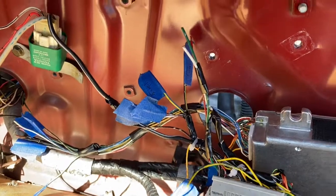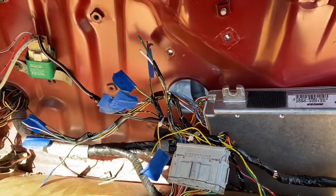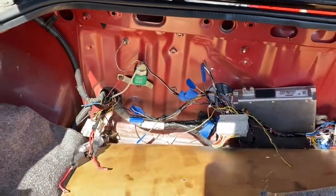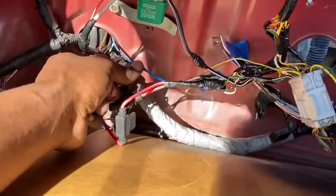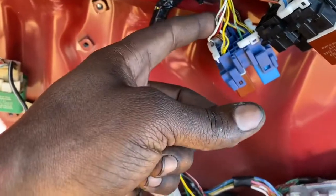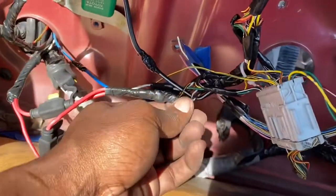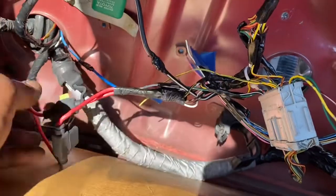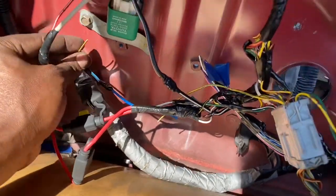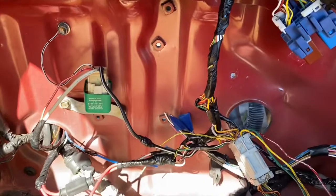I'm gonna connect those for now and we'll come back and show you what's basically left to get the car to start. The fuel pump is now wired up to our yellow-blue wire — I checked that for power, all relays are good. The ECU has power: those three wires connected to switch and the black one straight to main power — that's basically our memory wire for the ECU. I still have to tap this into the alternator but I need to buy some T-taps, so I'll leave that for the next video.